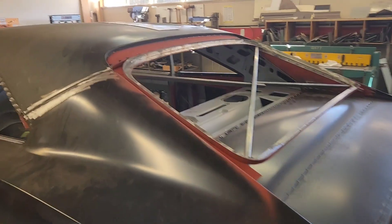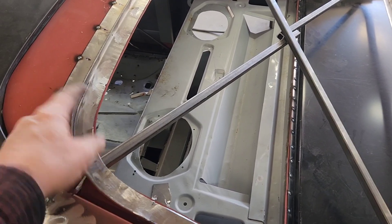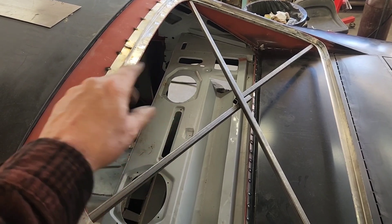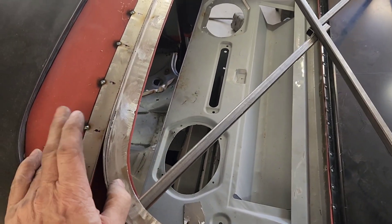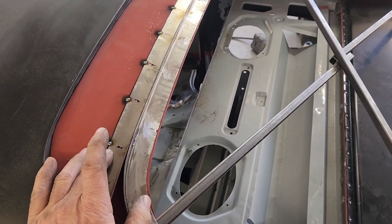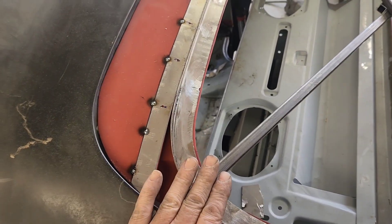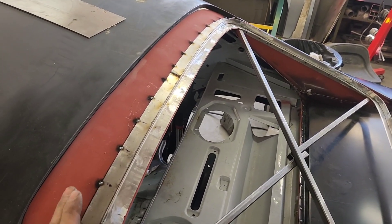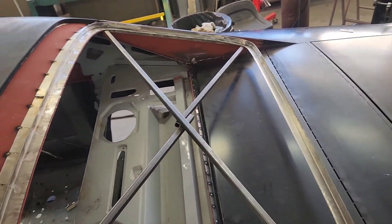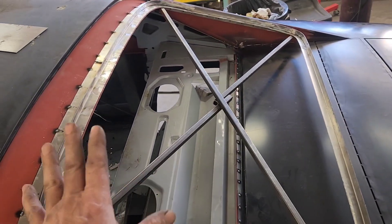Still secured with four screws to the car through these side rails, I've added a kind of reverse of this shape to add a little strength in this direction to this upper bed. Once the skin is connected from the existing roof to this track, it'll create a box - a compound shape that should take any rotation out of it. Also, once the glass is in there with the urethane, the urethane will basically secure it to the glass and stiffen it up. Modern cars, the glass is part of the calculated structure - on old cars it's just set in there, but I'm using urethane here.